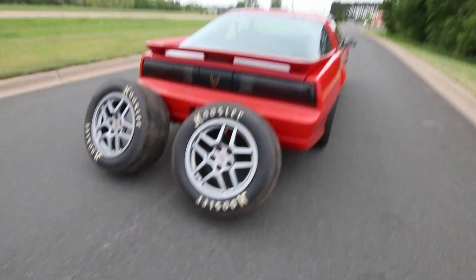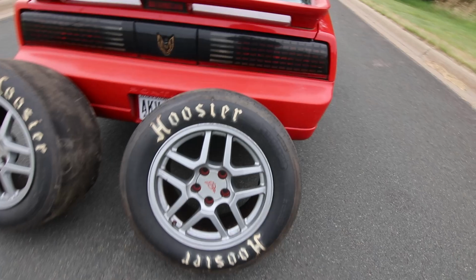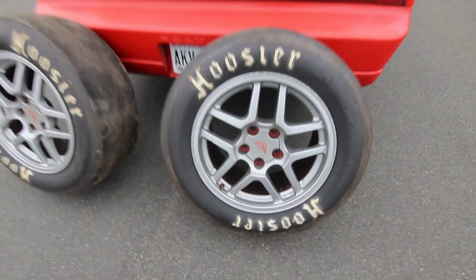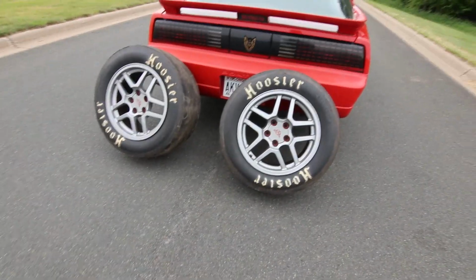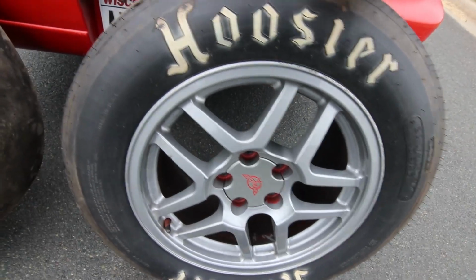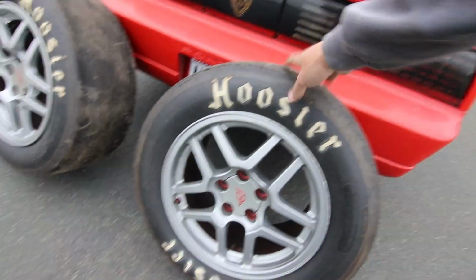Alright, so this went successfully. The tires are in pretty good shape overall. There's only a couple of passes on them. A little curb rash on the wheels, but overall, this is what I'm looking for. They're OEM Speedline wheels. They're 17 by 9.5, which is actually a front runner. It's upside down, but 17 by 9.5 and a 54 millimeter offset. So these are factory OEM Speedline wheels. These would have came on a C5 Z06 Corvette, and these wheels and tires are really light.